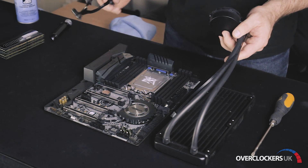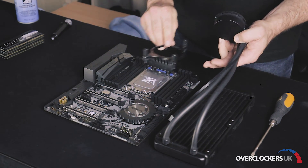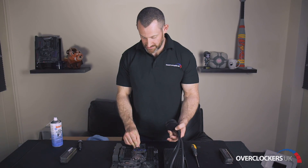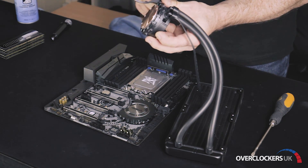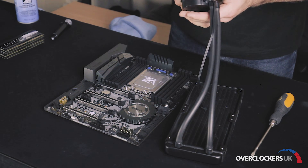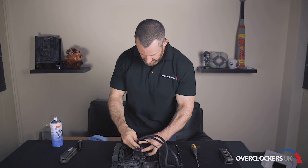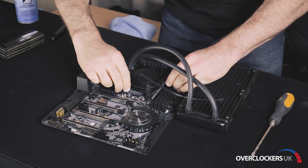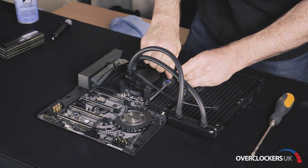The orientation of the bracket is going to be with the fat end facing down the motherboard and the thinner end at the top of the TR4 socket where I'm stood. There are hooks on the mounting bracket itself and little inserts on the head for where those hooks should go. I just push it in, hold it in place, turn it round, get the screws nicely in line, and give them a couple of turns first — then I tighten them up in order moving round.